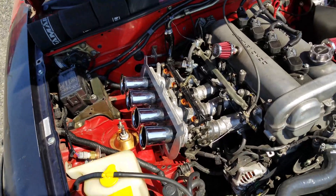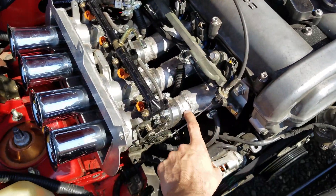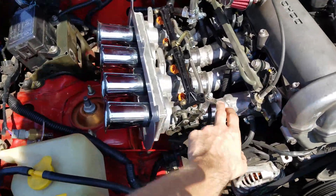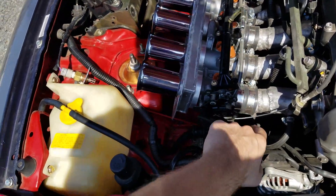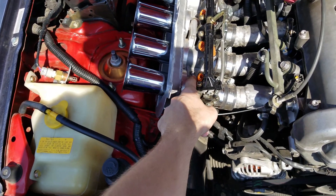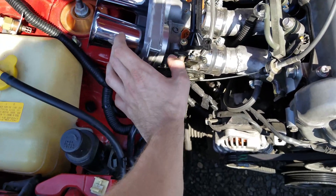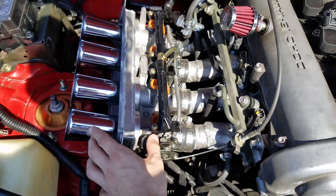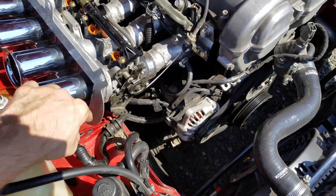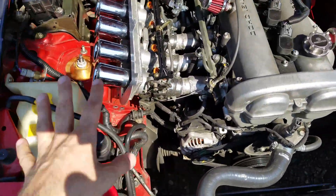What this actually is, is a 1.6 Miata intake manifold that someone cut right around here, and then they welded an aluminum pipe — TIG welded it at a slight little angle going up this way — and then they silicone coupled the GSX-R 750 ITBs. There's a little aluminum piece that adapts the GSX-R ITBs to a PX600 baseplate with Weber 48 IDA velocity stacks bolting it all directly to the GSX-R ITBs. I'm not 100% certain how those aluminum pieces are attached, and I'll be figuring that out today because I'm actually going to be making an intake plenum that goes over all of the velocity stacks so I can route boost into this intake manifold in the future.